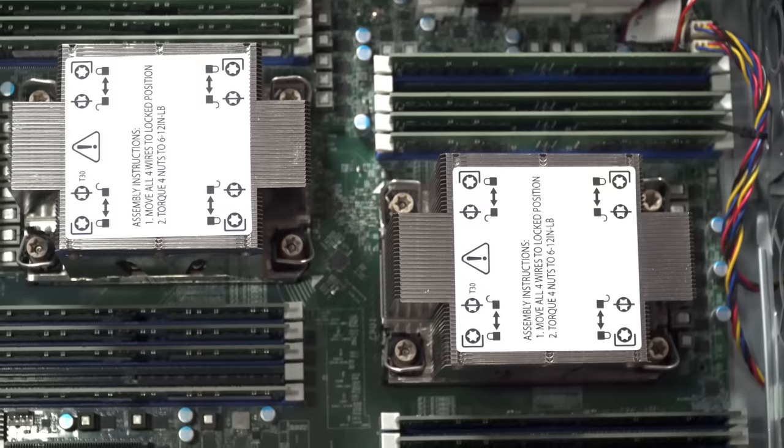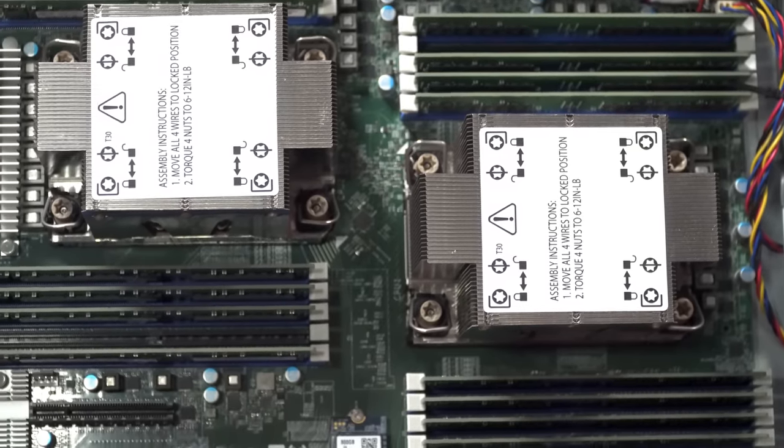While the Optane technology originally launched with second generation Xeons as Persistent Memory Modules (PMM), Sunny Cove introduces a new series of Optane 200 DIMMs, or PMEM 200 — because Intel is just as consistent as Microsoft when it comes to shorthand acronyms across generations. Putting persistent memory closer to the CPUs allows for lower latency and faster speeds, even compared to the best M.2 and U.2 NVMe solutions currently available.